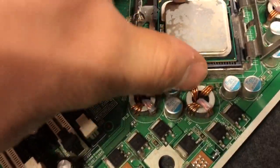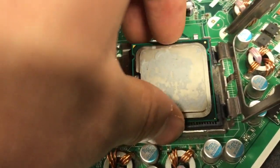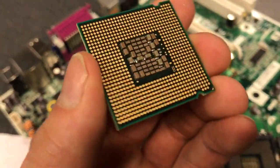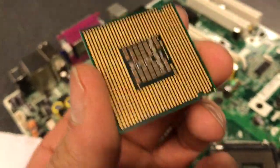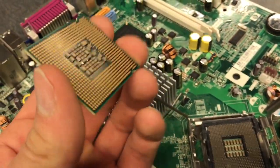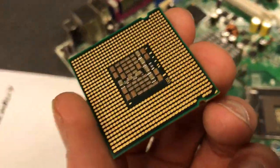Once you get this all unlatched, you are going to very carefully pick up the CPU. I'm doing this left-handed because I'm videotaping, so it's a little shaky. You're going to notice most likely pins — this one doesn't have any, surprisingly, but a CPU normally has pins on the underside. The pins are on the CPU socket on this one. Very carefully remove the CPU from its socket. You do not want to touch the bottom, and you want to make sure that you are holding it at all times. Don't set it down on the table — you don't want to risk damaging it.